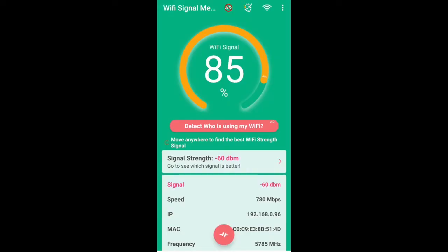I've reviewed a lot of Wi-Fi 6 routers over the years and I've been doing the same basic test. When I installed this in my living room, the wireless signal was 100%. Sitting in my studio about two rooms away, it dropped to about 85% — pretty strong. Out on my back deck the signal dropped lower, and I was curious whether Wi-Fi 6 fixed the range limitation of the 5 GHz band compared to 2.4 GHz. It didn't — when I took my phone to my back shed on the other side of my property, there was no signal at all, so that's an issue.